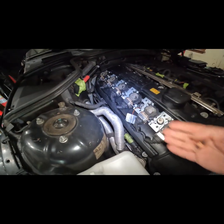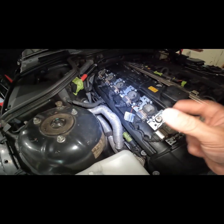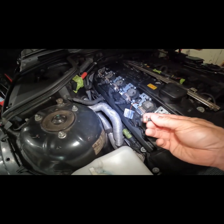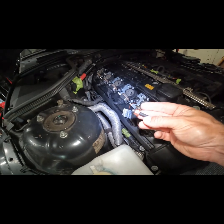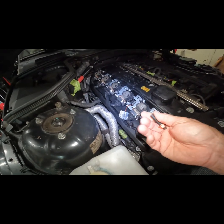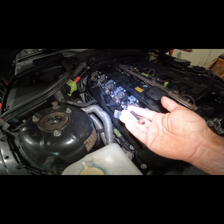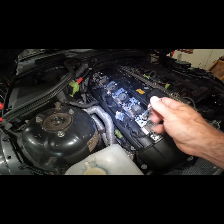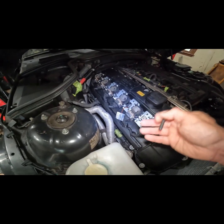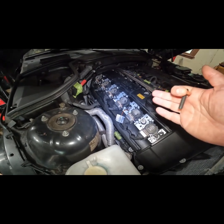It's a little bit easier to get to the studs and tighten everything with the O2 sensors out. It's not the easiest thing to get to these exhaust studs — you do need to get some swivels and you have to get a little creative. I believe this was an M7 by 1 thread. The M7, the size in general, it's about a 15 newton meter torque spec. I would start at maybe 12 to 15 newton meters if you want to torque it down. But realistically for an exhaust manifold, I'm going to snug them up a little bit at a time and then you'll be good to go.